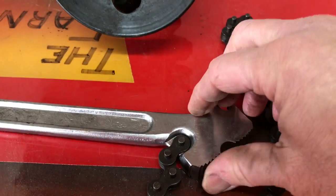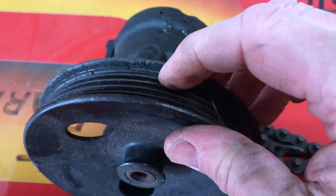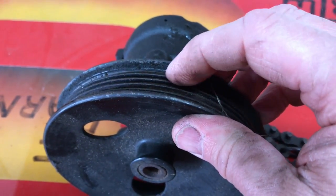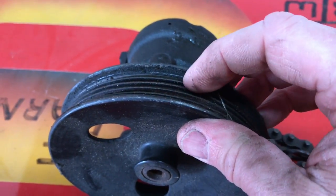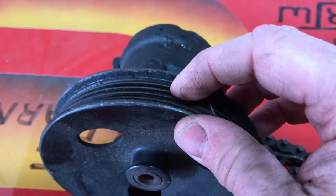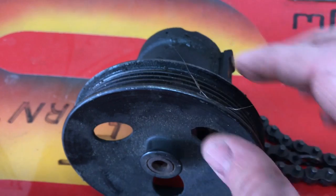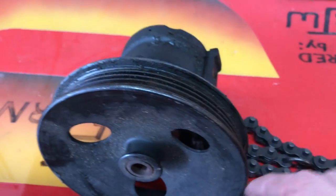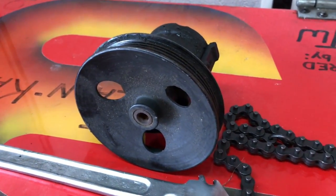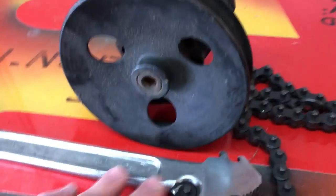This is really hard steel. So if it leaves teeth marks, it's going to be right here in your grooves. So I always wanted to clean that up with a file or a cutting disc on a little 90 degree die grinder. I would straighten up any marring that the tool might've put on the pulley — because otherwise it will cause damage to your serpentine belt afterwards and cause a premature serpentine belt failure. So I always make sure I spent the time to clean up if I had to use this tool.